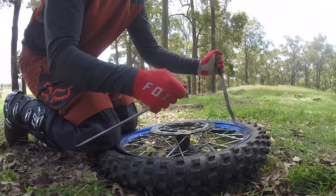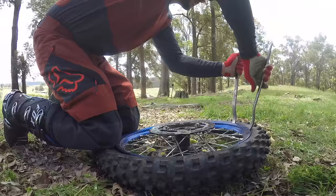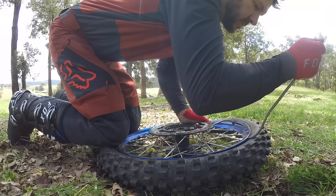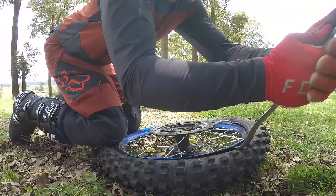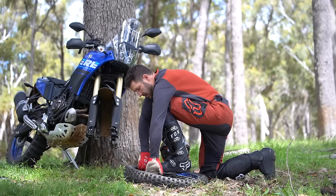These are the best — you use these little lips and just hook them in. Don't get too greedy, just that width is good. One, two, and just wriggle that out. Take another bite, just go easy. I'm being gentle here because I haven't actually popped the tube, so I'm going to reuse it. If you've popped the tube and you've got a spare, just jam it in there — rip the sucker out. Once you're there, you don't even need the levers, you can literally just get your fingers in there and pull the tyre off.